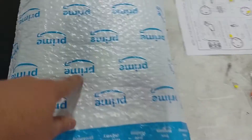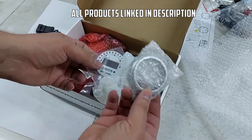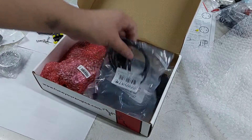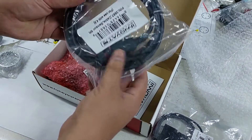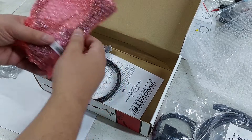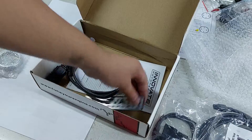And then we also have this — this was not so cheap. You get the white gauge face and a silver bezel if you want. You do get the bung — you don't get that with the cheap ones. This is a data cable if you want to connect it to your PC; you can download some software. This is quite a nice long cable — an eight-foot cable for use with the 4.9 sensor. This is the gauge, and here is the sensor itself — this is the 4.9 Bosch wideband. You even get a whole instruction manual and a sticker.